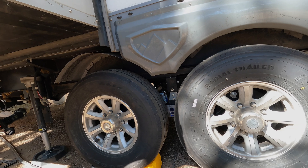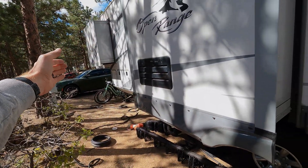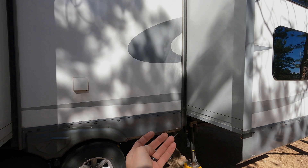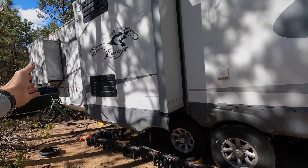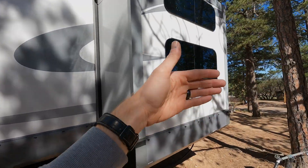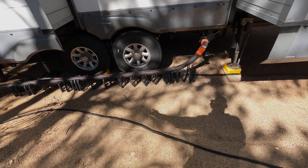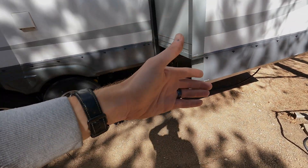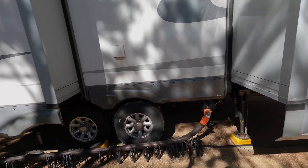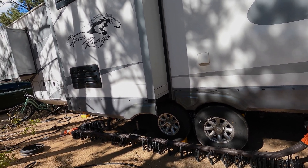All of these weights have to be calculated. If you have too much weight on the front and not enough on the back, that increases your payload into the truck. Likewise, if you move things back — say, take stuff out of the underbelly and put it in the back bedroom for travel — that creates a lever effect. The front end picks up and the back end comes down, transferring weight onto the axles and off the kingpin. It won't be one-to-one, but you can use that concept to balance things.